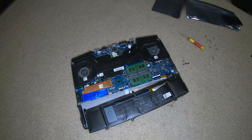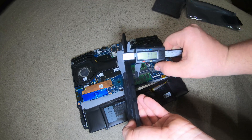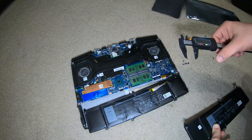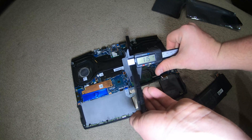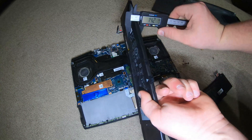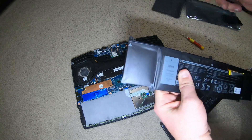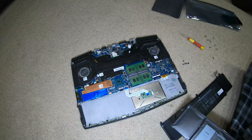I didn't feel like editing so I just left the camera on. The original battery is zeroed out at 7.5mm thickness. The old one reads 11.7, 11.5, 12.1, 10, 10.8mm across different cells — this is the only cell I had that was good at 8.1mm. So I'm going to compare them and get some photos to show people.